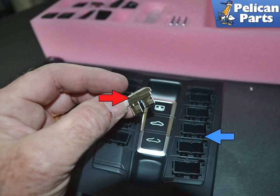The blanks will completely fill the space. The options that you will want to install the cover switches for have a chrome trim piece, red arrow, that goes on the bottom of the switch and should be installed before the switch cover. Again, these are unique to each side and should slip right in.